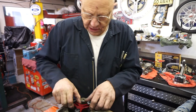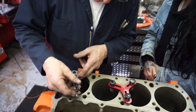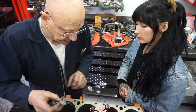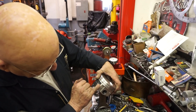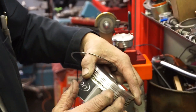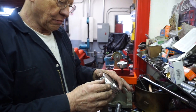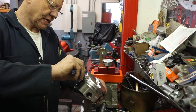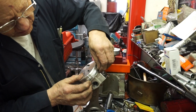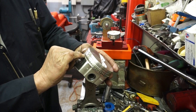Most critical is the top ring because that's subjected to the most heat. The top ring kind of shields the second ring. Looks good. We've got each end gap stamped. It looks different because it doesn't go all the way across. What we want to do is set that over there — you don't want the gaps lining up. Roll this one in, then take the bottom one, bring him over here at about 2 o'clock, and then gently push down, roll it back around here, clip it into place.